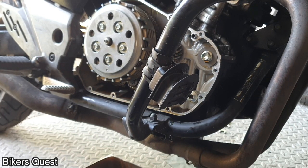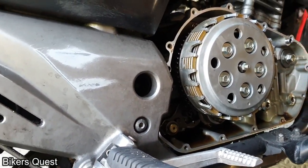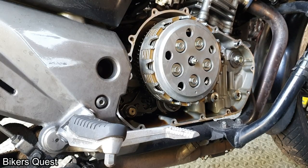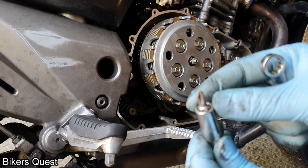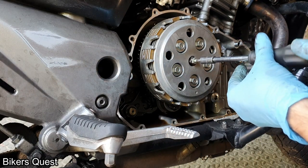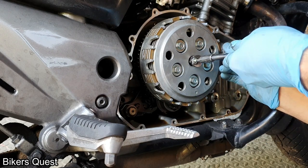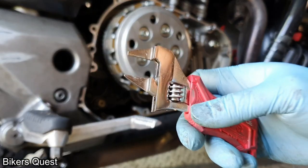That's the clutch side case, and now I'll show you the screw adjustment. You can see the nut in the middle of the clutch basket — there's a lock nut and a screw on a square sort of shaft. The manual wants you to put the screw in with a 10mm socket. When you spin it the shaft spins as well, so you can't easily loosen the lock nut on its own — you need to hold the screw. I used a lot of effort here and it wasn't loosening, and I nearly stripped the screw last time doing it that way.